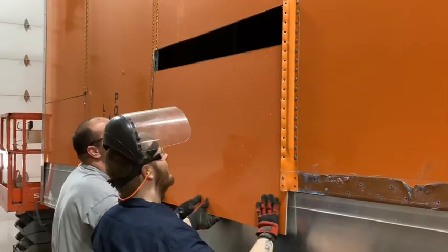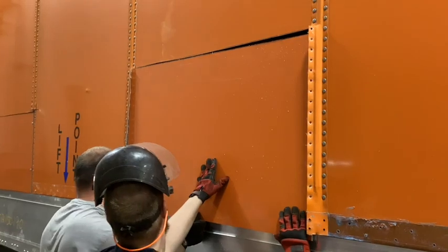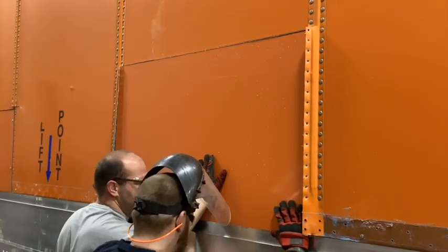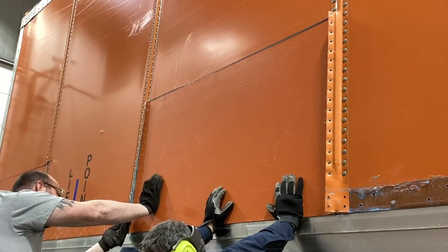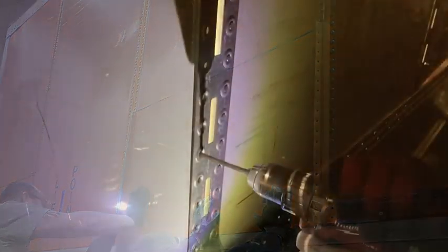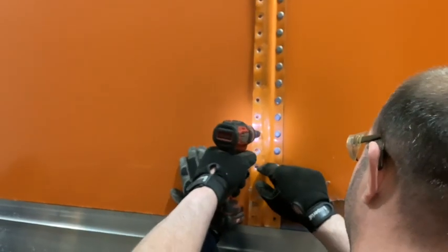Now that you've got your panel cut, it's time to do a test fit. Go ahead and put that panel into place and make sure that it's secure. Check your measurements, and recruit some friends if necessary to hold it into place while you get out your quarter-inch drill, drill a hole, and grab some quarter-inch nuts and bolts, because we're going to secure them from the inside-out or outside-in depending on location, to make sure that the panel does not move when you flatten the posts and prepare to buck rivet.